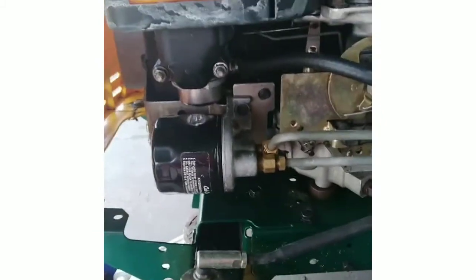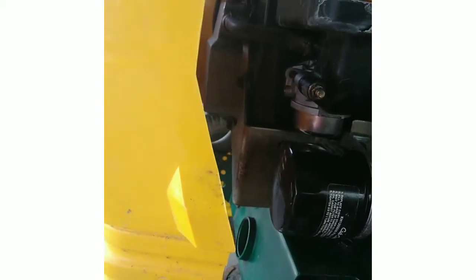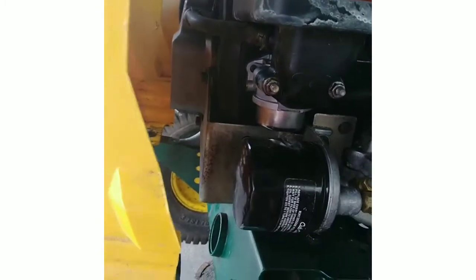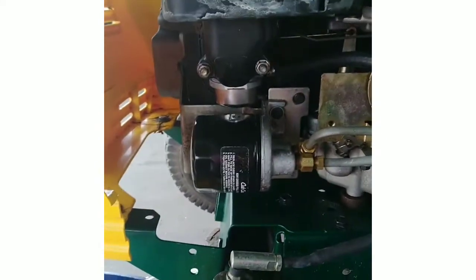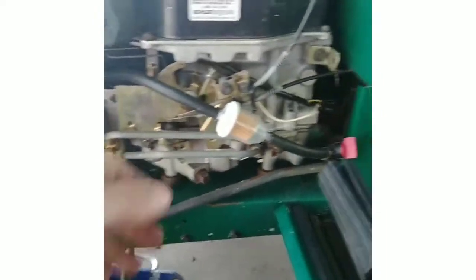Okay, before I started up, like I said, I replaced the carburetor with a new one I got from HIPA. Thank you, HIPA. The only issue is this engine does not come with a backfire solenoid switch, so I had to take the bowl nut off the other old carburetor to put on this one. Since this one does not have a backfire solenoid, it should be alright because it doesn't really affect it. It shut off pretty good without backfiring.